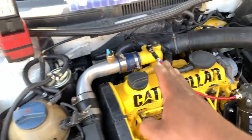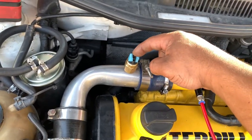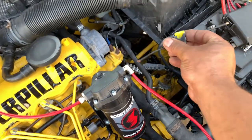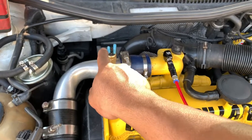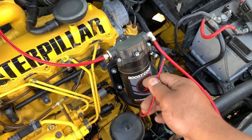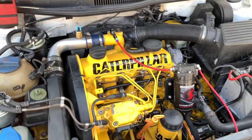These are way more accurate. The wiring is very easy - I'm not going to go crazy. Just straight power to this switch, and the switch sends power to the pump once you're building boost and it reaches the set PSI. I'm going to add a fuse before everything. That switch sends power to the pump - very simple. I can also wire an indicator light right here into the dash attached to it, so it tells me when the pump is on. I've got the light right here and I'll show you a trick about this light later.